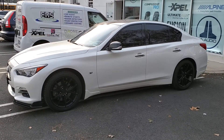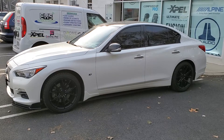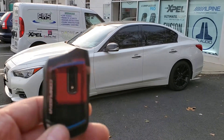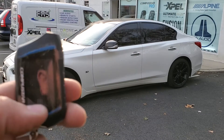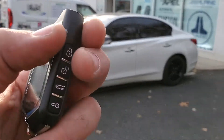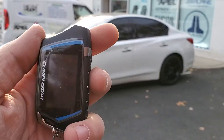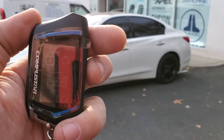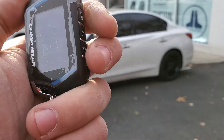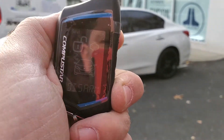What's going on everyone — here I got this 2015 Infiniti Q50, we installed this Compustar remote start system. This is a two-way remote with an LCD screen. You have your buttons on the side: lock, unlock, trunk pop, and remote start. If you hit unlock it comes up and gives you a notification, and if you hold the key down for about three seconds it activates the remote start.